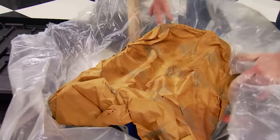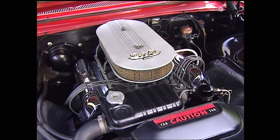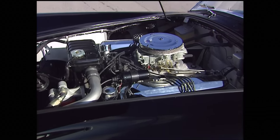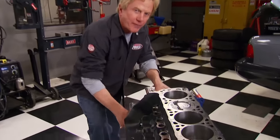That power is coming from a new version of Ford's famous FE-427, a midsize engine that was a mighty weapon in Ford's battle plan during the muscle car wars. It used a cast iron block with a bore of 4.235 and a stroke of 3.785. We're going to build our own modern version of a 427, starting with a new Boss 351 block.